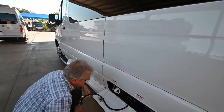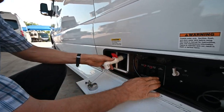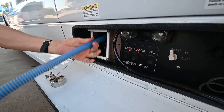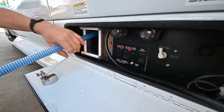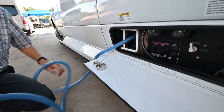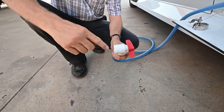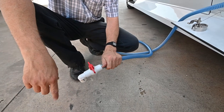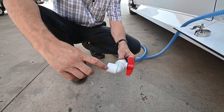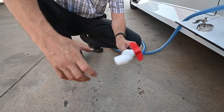Here's the outside shower if we want hot and cold water on the outside. For the sewer connection, push the top of the button and that will extend the hose out; then we can manually pull it out once the gear drive releases, and this will go down into your sewer. A lot of guys will adapt this down into the sewer connection — most RV sites use a three or four inch connection. You can get a small piece of piping here and something called a donut that slides on there and seals the sewer to keep sewer gases from coming up.